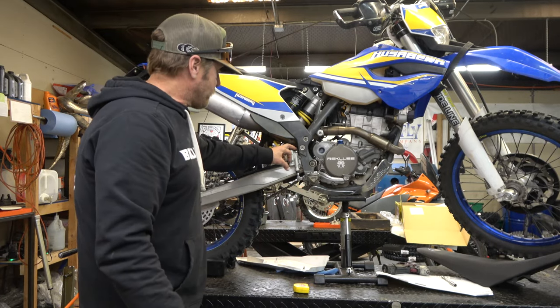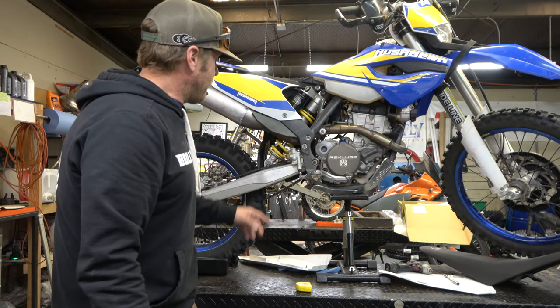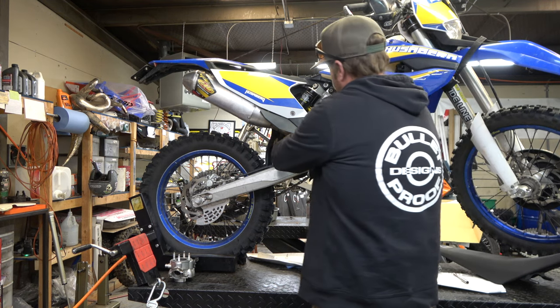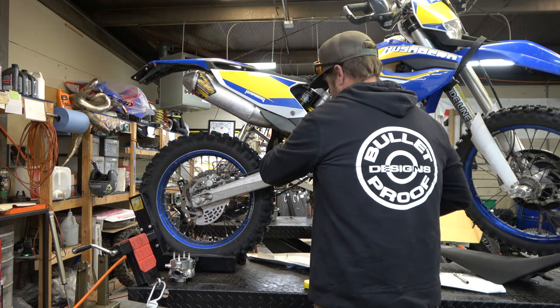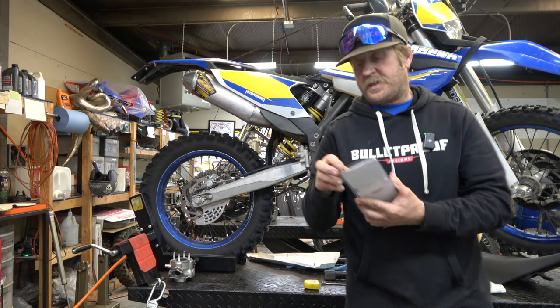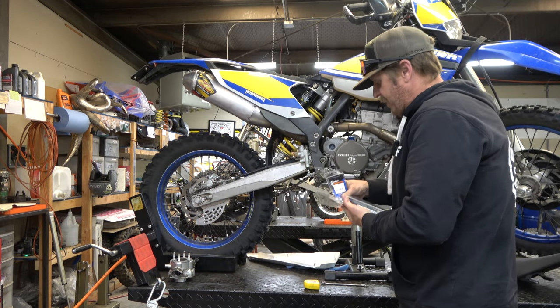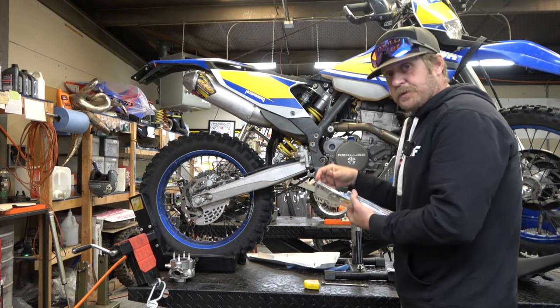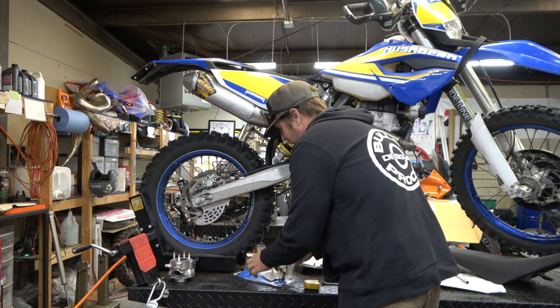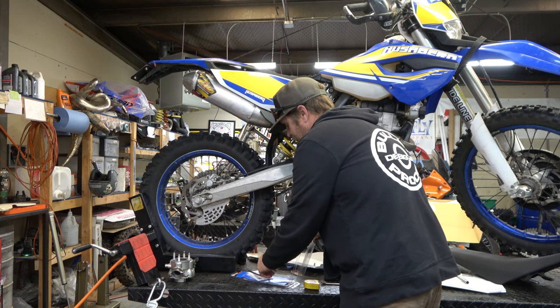All right, guys, so it's going here in this rear banjo on the master. Amazingly enough, it is a 12. The thing about these banjo bolts is if you have everything ready and you swap super fast, you'll still need to bleed it to get a little bit of air out, but you can actually make it happen. It can actually work